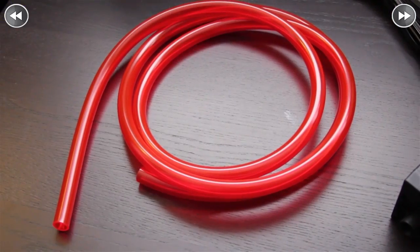First things first, you're going to need some tubing. We have the Master Clear here — it is a red tubing and it is half-inch inner diameter. I prefer half-inch inner diameter, but you could go three-eighths, seven-sixteenths, all sorts of sizes. When it comes to size, they're not going to perform any differently. It's just that as you add more blocks and components to your system, you should go with a larger inner diameter for better flow. It has nothing to do with temperatures.